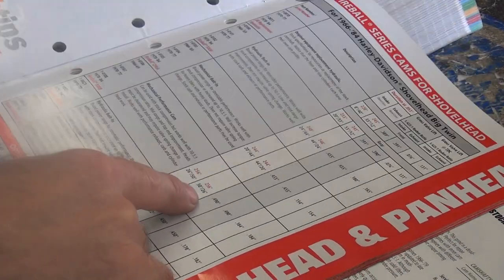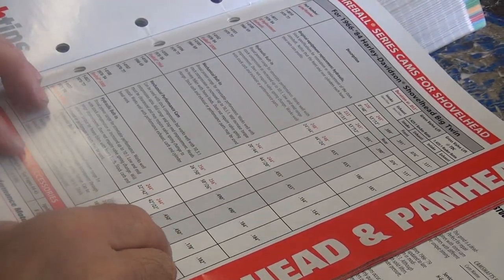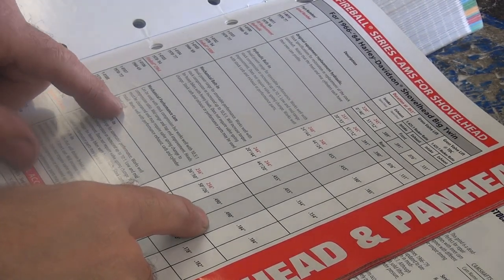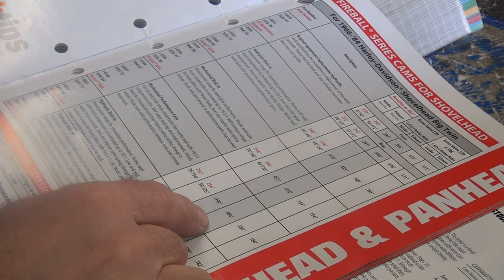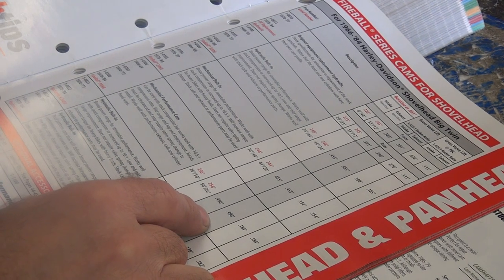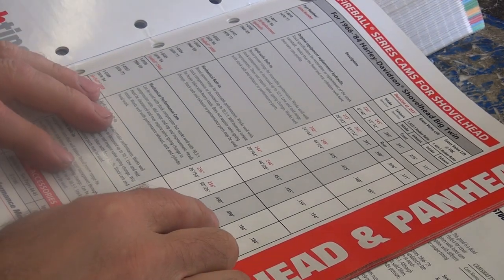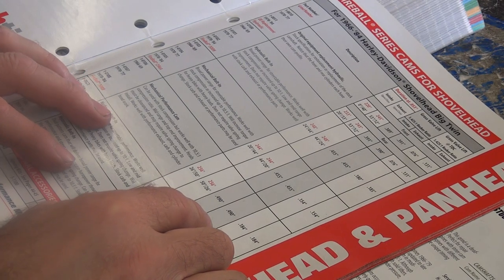Fireball. There you go, 256. 316. Only 490 lift. Perfect. Works well with performance exhaust. You have performance exhaust on that bike, sir? No, I have stock panhead junk. Oh well, it'll work anyway. It works up to 10.5-to-1 compression.